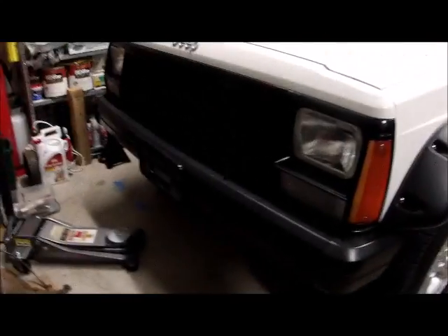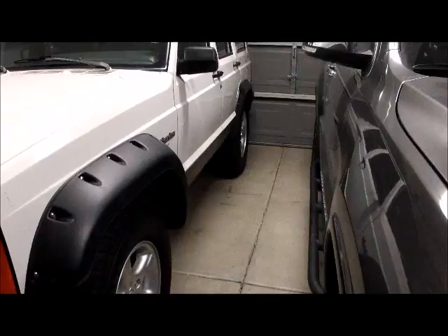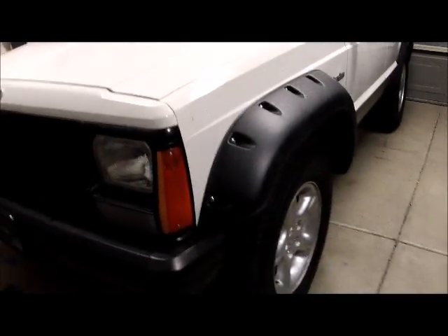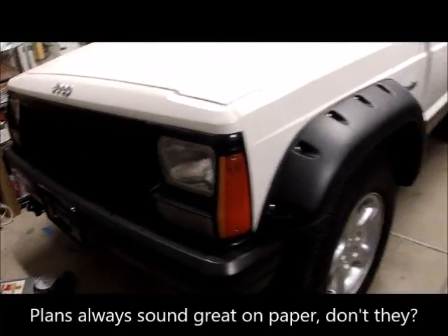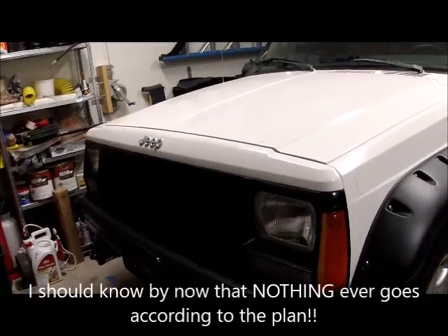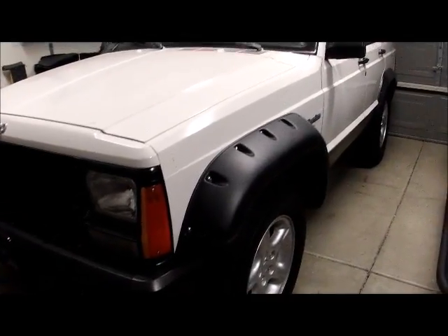The Jeep is getting ARB lockers front and rear. The front Dana 30 will be rebuilt after the lift is done. The plan is: install the rear lift, get the SYE kit from Advanced Adapters, get a measurement for a new rear driveshaft, then work on the front lift. When the rear driveshaft comes in, I'll pull the front driveshaft and drive it in two-wheel drive to the shop to match the front gears to 4.10s. Then the front driveshaft goes back on. In the meantime, I'll do everything cosmetic I can. Thanks for watching — hopefully the next video covers the lift kit install as Project Simon builds.